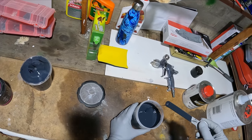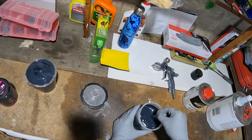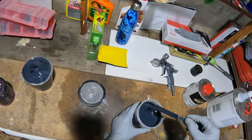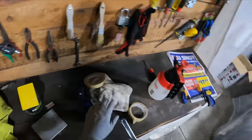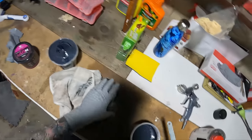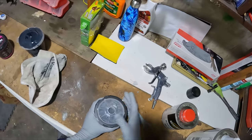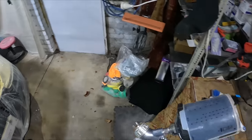That's looking good — not too thick, because I don't need a thick primer. It's more of a primer surfacer in this instance, something to seal it down with. I'm going to go three coats, and might go an extra coat on that guard where the filler repair is. That repair doesn't have to be perfect and it's not expected to be. I'll put the respirator on and stop talking.